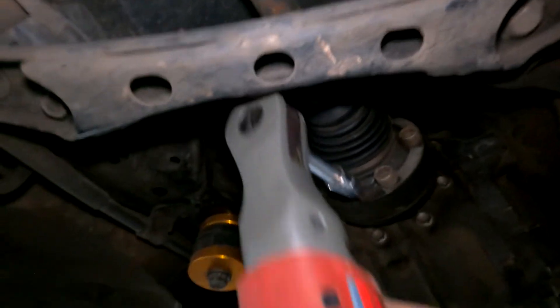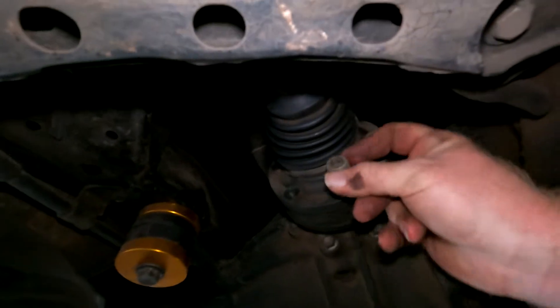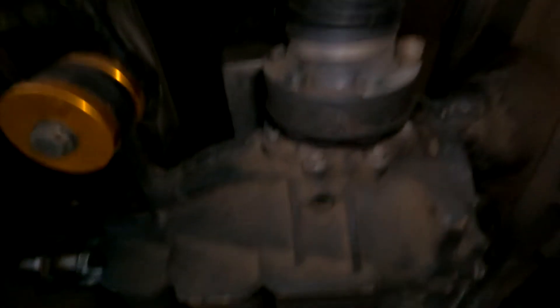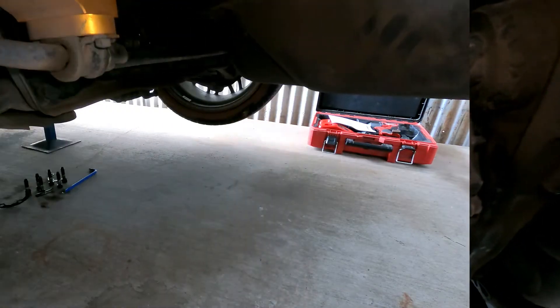These aren't too bad. Dry again - so the right inside has got an issue on the CV. Left inside seems to be fine. These CVs do click on the outer CVs, but I don't really care about that. I'll get these axles fully unfastened and then we'll drop the diff. There's three bolts in the back and two in the front.